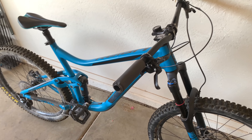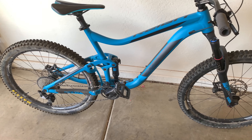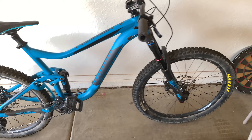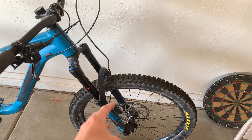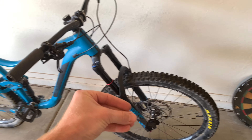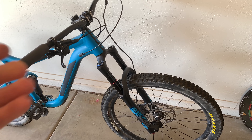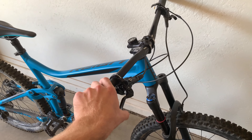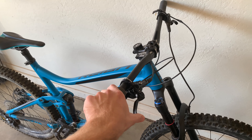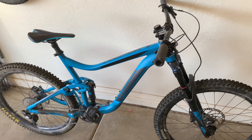That's a good indicator that you need more brake fluid. The reason this happens is either it's old, some evaporated, a little leaked out, or — the biggest thing I've noticed — when you take a wheel off your bike and accidentally hit the brake lever with the wheel off. There's no disc brake to stop the calipers from squeezing all the way, so they squeeze together too far and the hydraulic fluid leaks out behind them. That's actually what happened here — I put my friend's bike in a car and accidentally squeezed the brake.